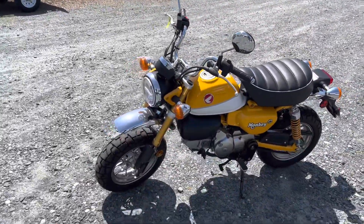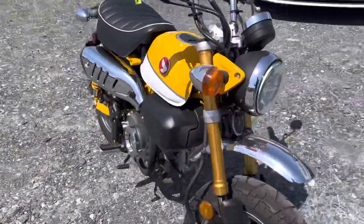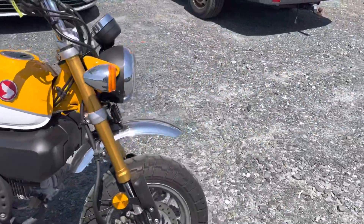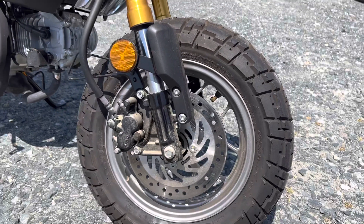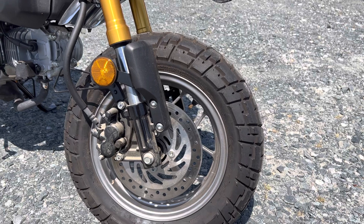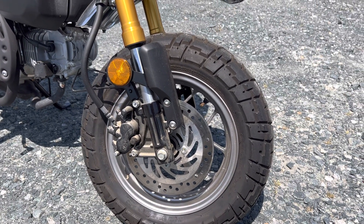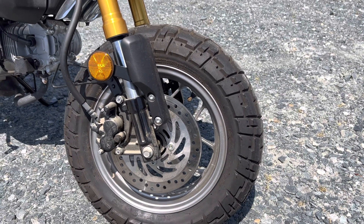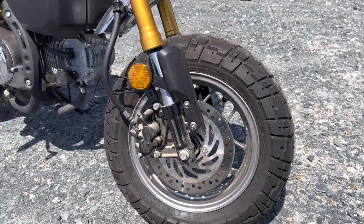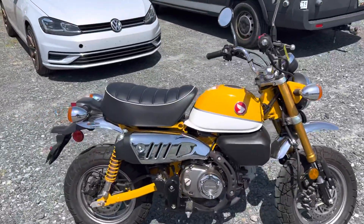As far as tires, we're looking at a 120/80-12 in the front and a 130/80-12 in the rear — a nice fatty knobby tire. They come with a V-Rubber block-style tire, a popular scooter tire. The Shinko Mobber should be an option if you want a little more knob, and probably look at the Michelin Pilot series if you want more of a street tire for city commuting and rain. I like this tire — kind of down the middle. You could pit-bike this thing on gravel like we're filming on today or just do regular street riding.